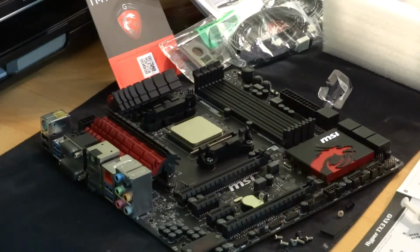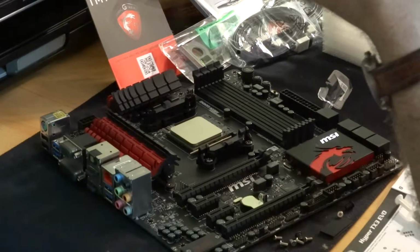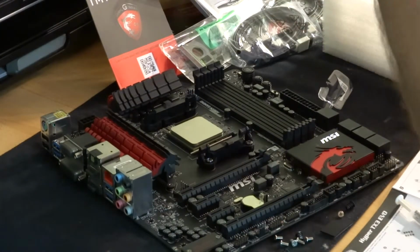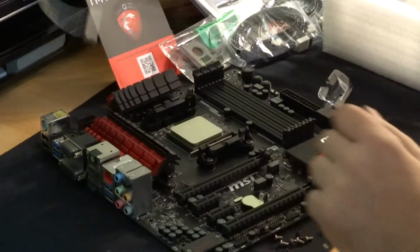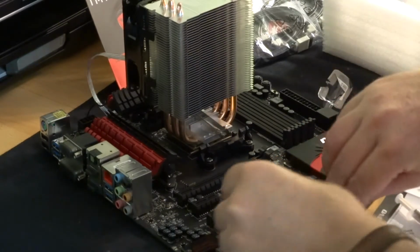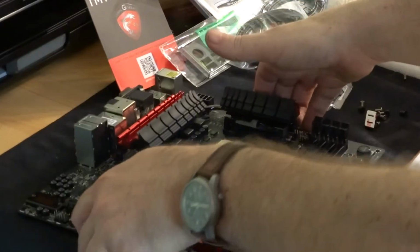Let's take that off. Right, now you've got these grooves going through the heatsink plate. So this would slip into those grooves like that. Question is, have I just realised a deliberate mistake here, because on either side of the APU socket, it seems it doesn't go left to right towards the back, it goes from up to down, which is really bizarre, which means it's good in this case because I have vents on the top of the case. Not that this will need much cooling, well, not to begin with. If I decide to overclock it, it will, and I might be getting a liquid cooler to boot.